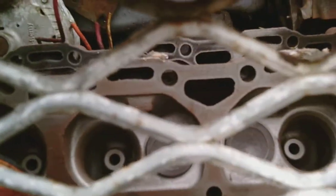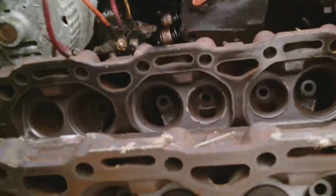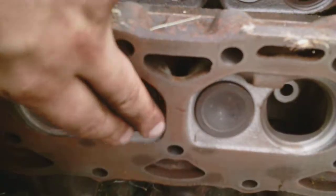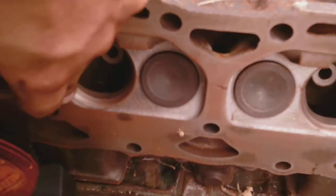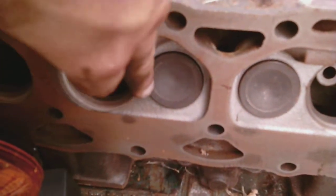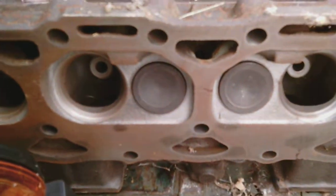There's another cylinder head that's the best, and it's the Vortec. This one's not Vortec because even though it's closed chamber, see how this is not all the way around circular? It has this little flat part. The Vortec one has a little V right here. So those are really great heads to have.